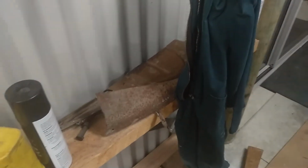The only other thing we're going to have to do is, we were looking at rebuilding these pieces and just patching them up and repairing them, but we think they're a bit past trying to weld up. They're too pitted, so Dad's going to have to order another inner panel. I think the guys in the South Island supplied a lot of parts for these Jags, and I think the Daimlers, which were similar models. I think he can order one shortly and get them to send it down. It's a couple of $300 to get that inner panel, which I don't know whether it's cheap or expensive, but it's quite a complicated shape. It's not real simple to make, and we haven't got enough material here to make one.